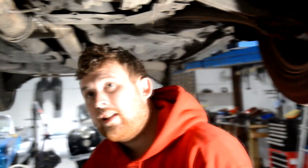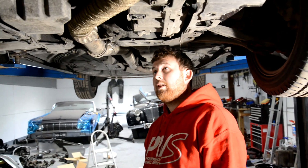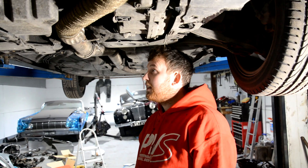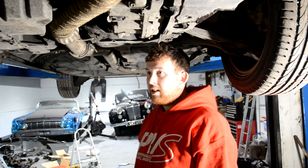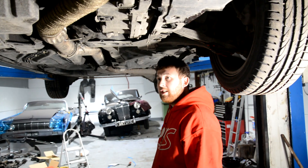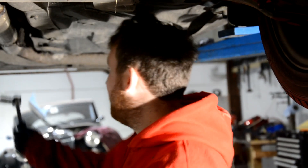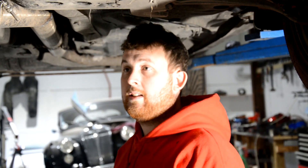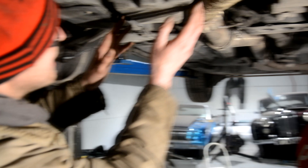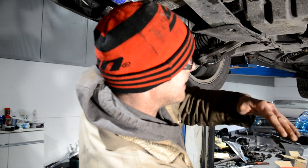Because when the back starts coming down, the engine starts coming down. Has the downpipe come off completely? I can leave it attached there. I'm telling you now that downpipe needs to — no, can I not undo it on the rebound? If it hangs just to here, it needs to come down and clear, because something's over here, so you need to drop it down at an angle to pull it out.